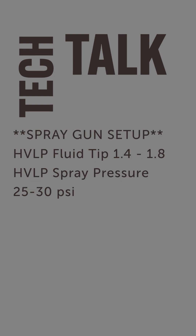If you're using an HVLP spray gun, they recommend a fluid tip of 1.4 to 1.8. If you're spraying it as a sealer with reducer and you're going to top coat with base coat, I would go toward the 1.4. However, if you're spraying thicker at just the one-to-one mixing ratio, I'd use the bigger tip — more like the 1.8.